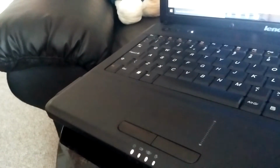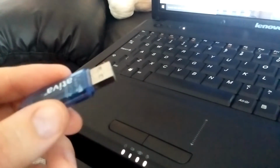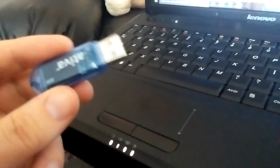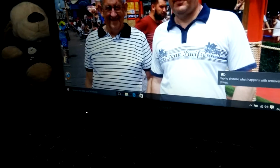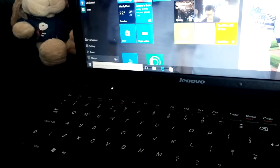Yeah, so guys, what you need is a USB pen stick. I'd say use a 2 gig stick because it's 838 or some megabytes. But if you've got any other bits on there, you're going to have to start scrubbing stuff. So use a 2 gig like this. Put it into an available port. Hold on a minute. Windows detects that. So you then, let me find my mouse pointer. Go to start. My computer.